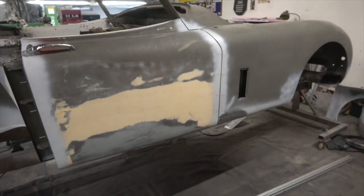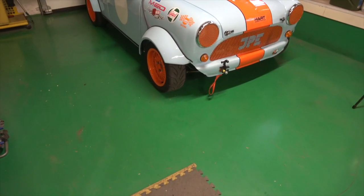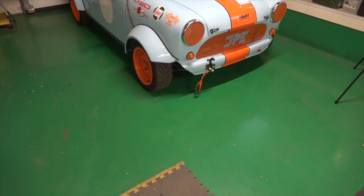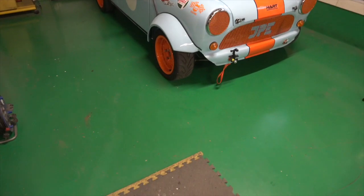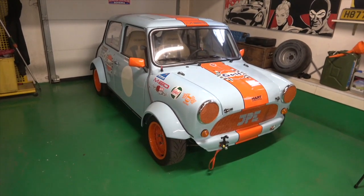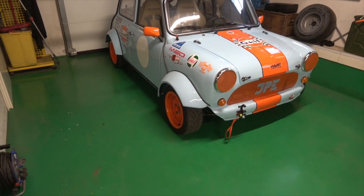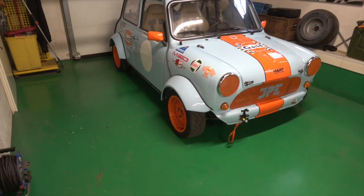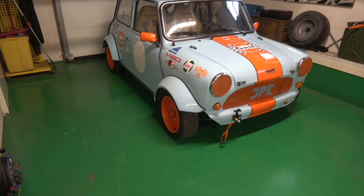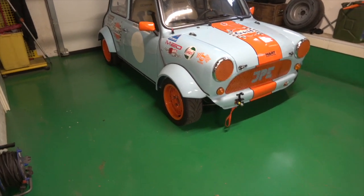Lastly, on the Golf Mini — you can see those wheels don't fit the arches right; they're not wide enough. I've got some 13x7s which fill that arch nicely and give it a better stance. When we were at the track at Pearce Racing the other day, at a fair speed going around the oval — which is pretty much left-left-left all the way — it was starting to skip at the back end. It definitely needs the rear anti-roll bar and the bigger boots. I've got two sets of wets on 13x7 so I'll need to make one of them a medium compound dry.